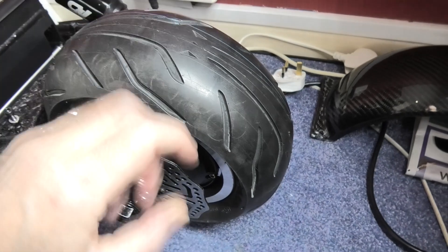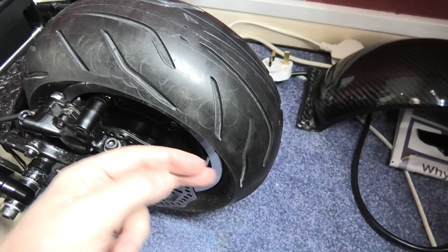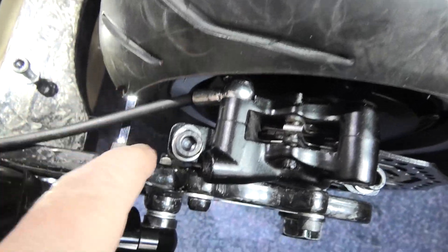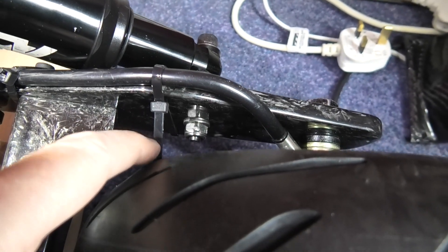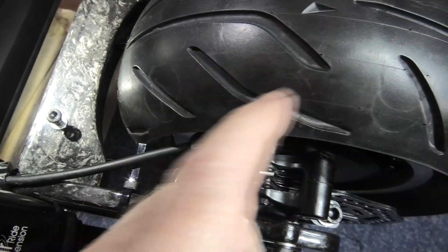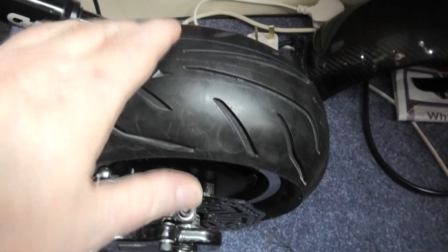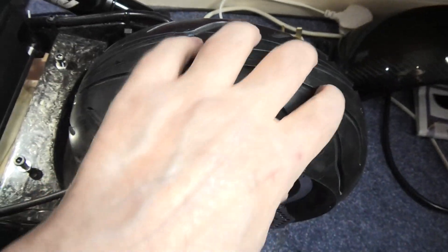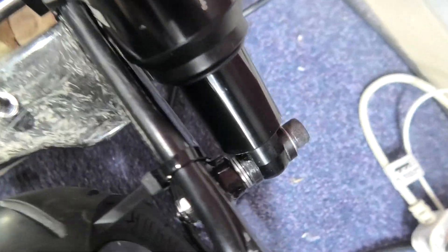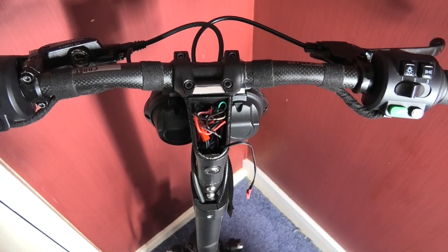I've trued the tire up. The problem with these tires is because they come out here - they don't sit on the bead very well because they're not pulling outwards, they're pulling sideways as well. What I did to true it up: these cable ties - I've got one there and one there - they're touching the tire on the outer wall. I turned it round, found exactly where it was rubbing, then moved that back and whacked it with a hammer to push it in a bit on that side. Keep going around it until it's all nice and true, then do it on the other side. It's not absolutely perfect all the way around but it's as close as it's ever going to be.